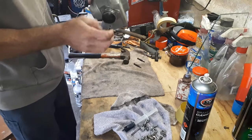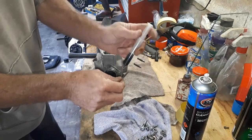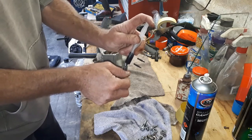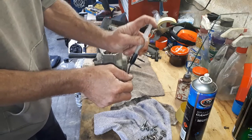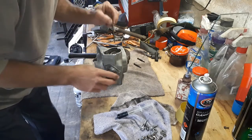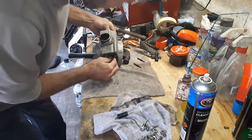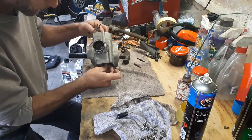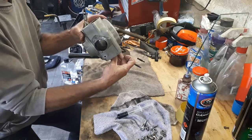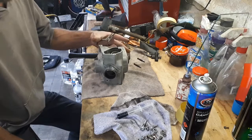And now I should be able to get this little shaft here. Again, just a little bit of two-stroke oil on there. So this is going to go down through the flapper and into the hole in that boost port, if I can get it to line up right. That's definitely in there now, and you might not be able to see, but if I turn that far side, I can already see it actuating the flapper there. So we've got that in the right spot.